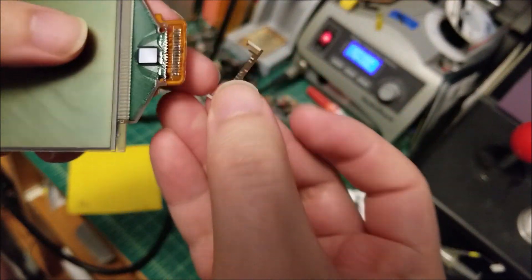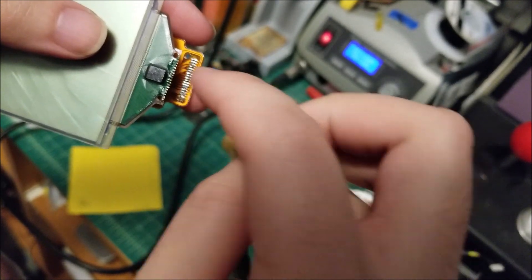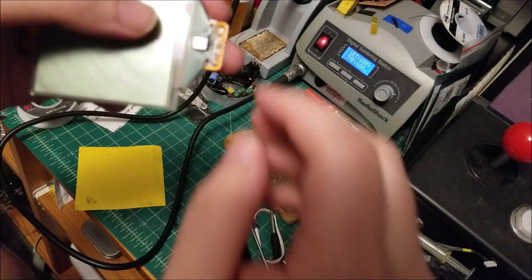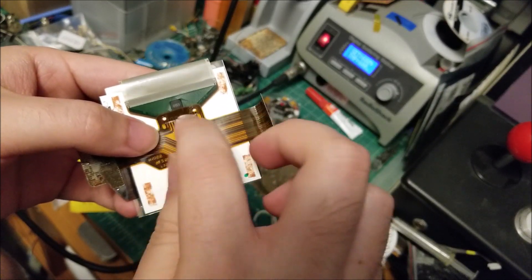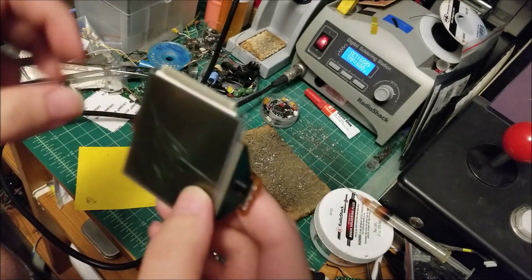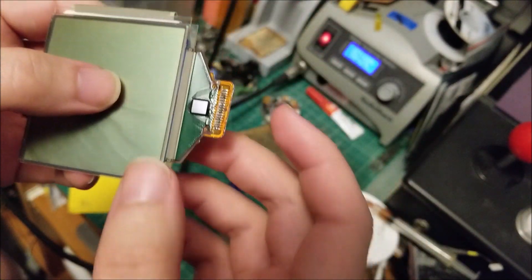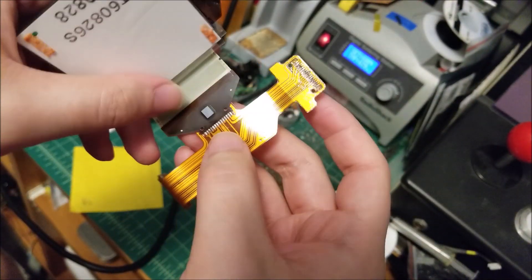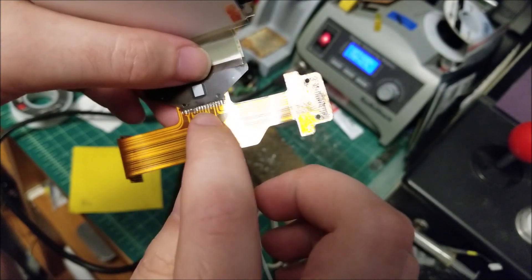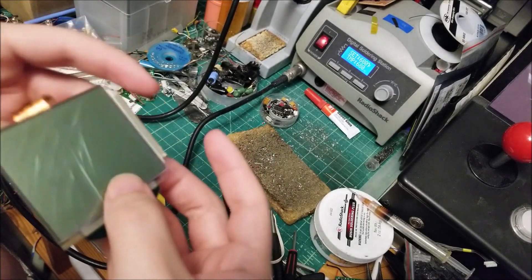You can see here I cut this off, but originally it's supposed to be like this, and there are tiny little wires that go between the top flex and the bottom one. He had only damaged the one on the back, but just to illustrate, I actually cut off the bottom one too. You might think that's a stupid thing to do since I just ruined the screen, but I want to show you it can actually be repaired — and this is exactly what I did. This one is re-soldered even though there are no pins. You might wonder how that works.